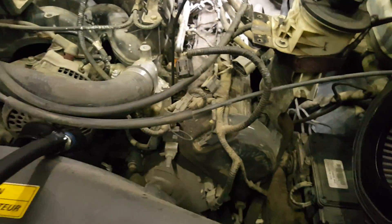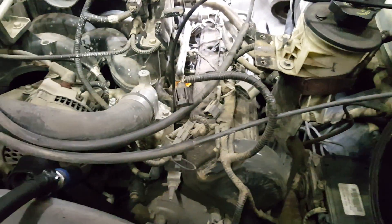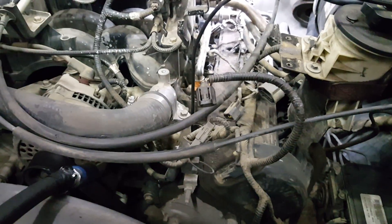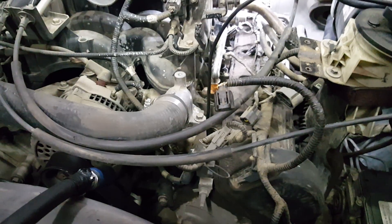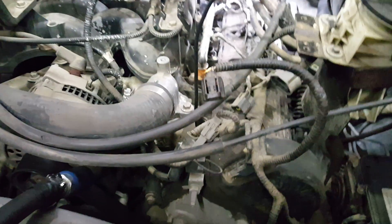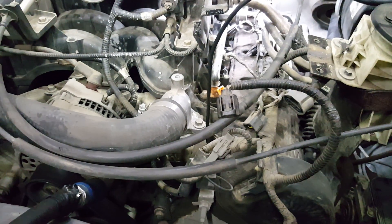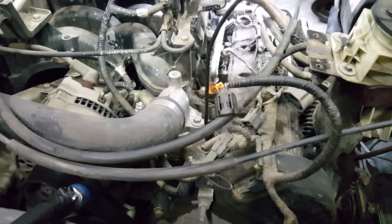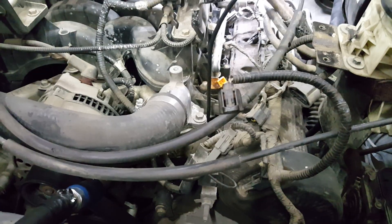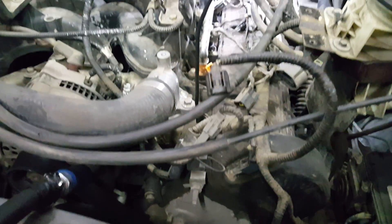So what we're dealing with is this F-150 with a 5.4 — it's got 85,300 original miles. It has the Ford factory Motorcraft plug in it, or it did till I pulled it out. Nobody has removed the spark plug from this cylinder head since Ford rolled it off the assembly line in 2001. Didn't have enough miles to change it — they're 100,000 mile plugs, so to speak. This video is basically here to help you understand what we're facing with the spark plug issue.